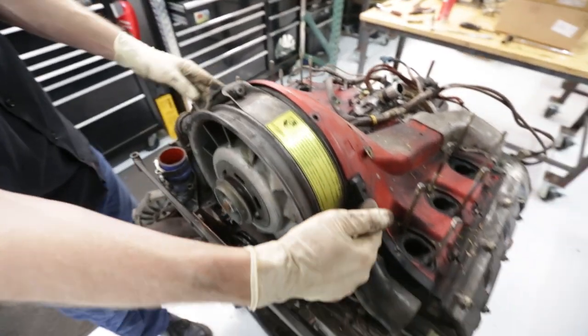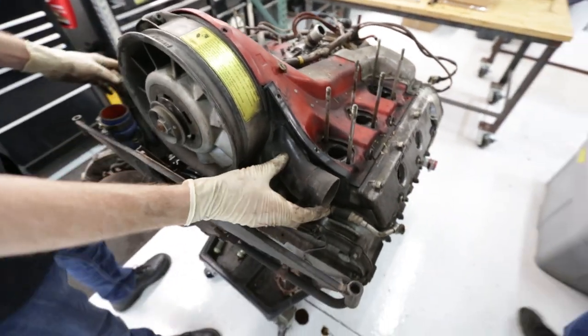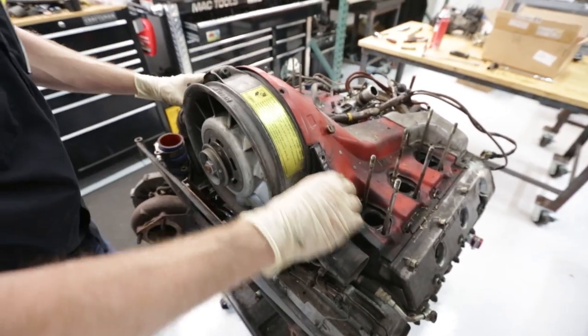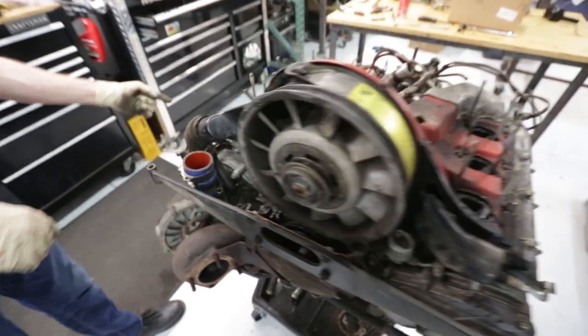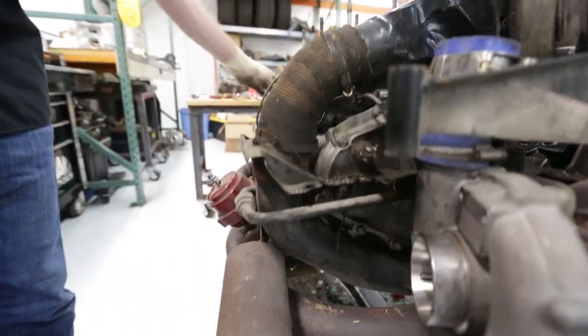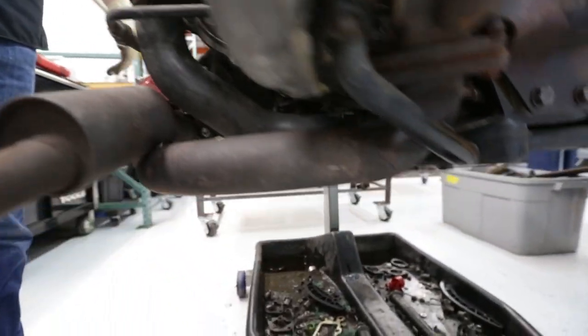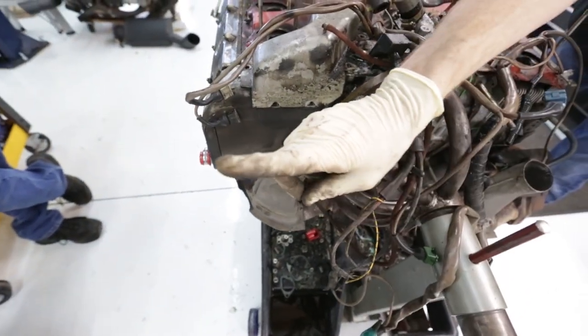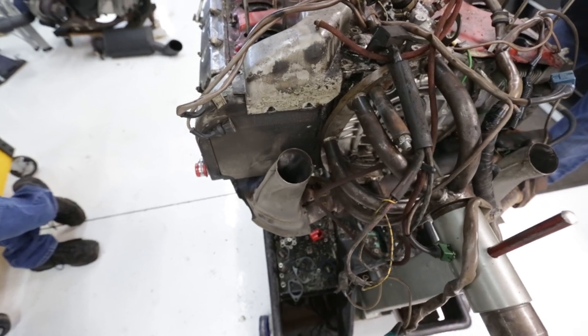And then at the same time, you have these ducts that come out. What are these all about? This is the heater system, the air source for the heater system. So this blows through these ducts, blows down into heat exchangers, which are wrapped around your header pipes. And then that comes out the front here and goes up into the chassis, and pops out the other side. It goes up to some fresh air mixing valves in the chassis, left and right. So you move the cable and, bam, you have heat. That's right, here's your source of heat.